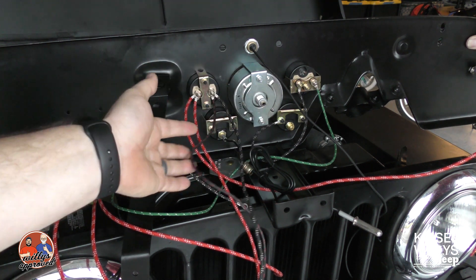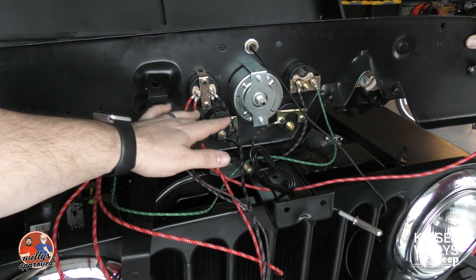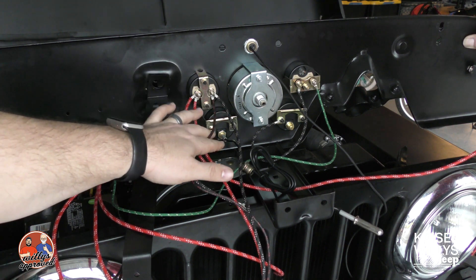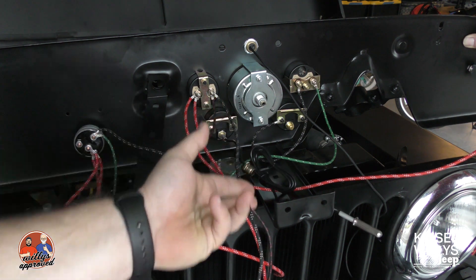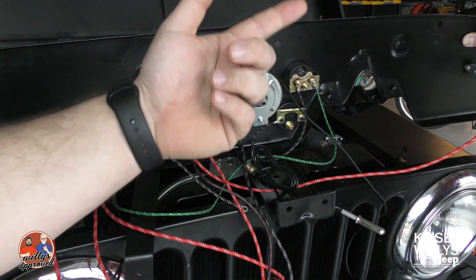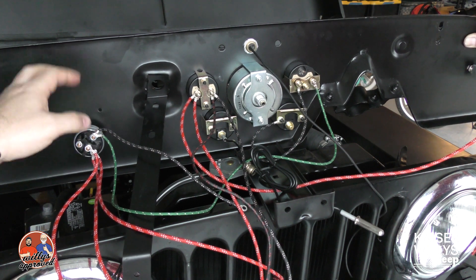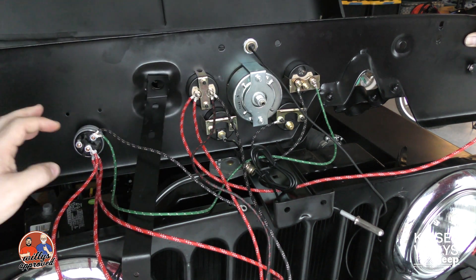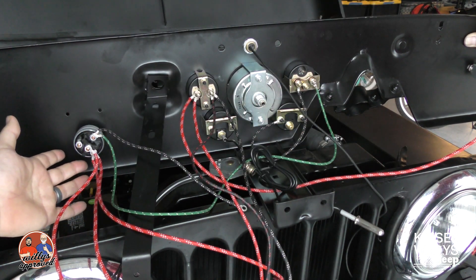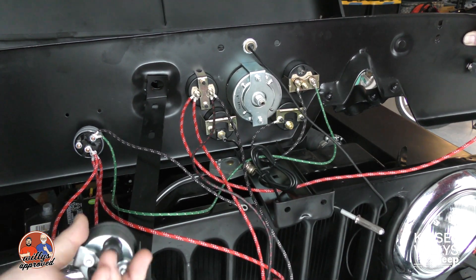This is actually your horn wire — it draws power off of the amp meter to power the horn. With the blade-style voltmeter, you're going to have to relocate this. You've also got a wire heading back to the engine compartment, and two wires: one jumping over to the headlights and the other transitioning back to the ignition switch. You're going to have to relocate power to the headlight switch using a wire going straight across, probably to the accessories tab.